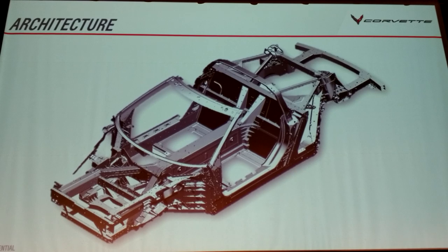You pour the aluminum into the mold so you don't get porosity. You get really good material properties and you can cast parts with very thin walls and very thin ribs, which is very mass-efficient. You take all these complicated interfaces and you can put them all in one part — and that's a real winner. Not having all those joints is a real win for body structure integrity.